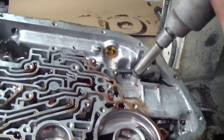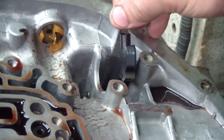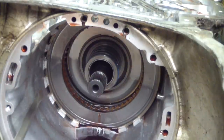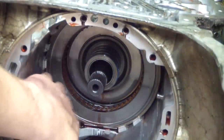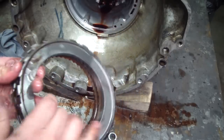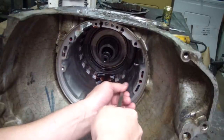Take the two bolts out the back to get the rest of it out. Here's the parking pawl — I'm just going to leave that in there and take the spring off of it for now. Remove the bolt that holds the center support in — got a 12-point thin wall socket, three-eighths inch. You remove a retaining ring that holds in the intermediate clutch plates. Here's a look at the intermediate clutch stack. Bottom plate was a wavy plate. Now I'm going to attempt to remove the center support to case snap ring.